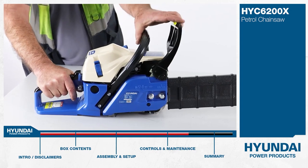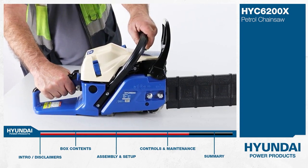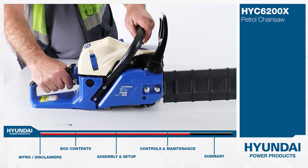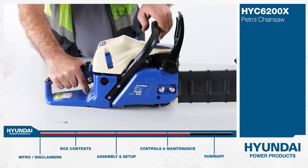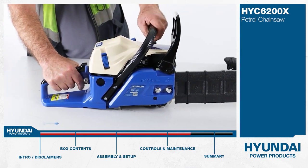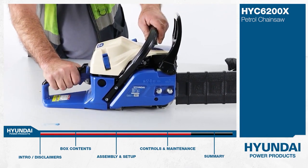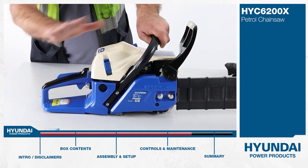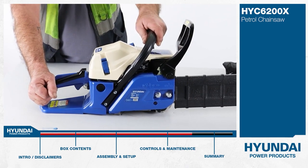Then obviously taking great care, we turn the chain brake off, and then we can gently accelerate the engine up until it gets warm and it's running evenly. A cold engine obviously will run a little bit lumpy to start with, but once you've revved it for a couple of seconds and it's gone up to full revs, pretty much you can let go of the throttle, the engine will idle. We would then put the chain brake back on to keep it in a safe condition so the chain can't rotate until we're cutting.